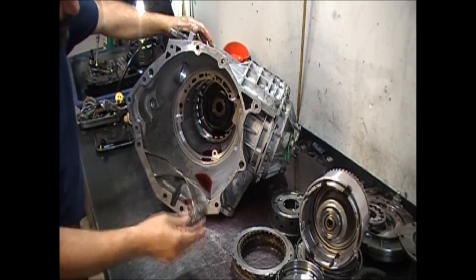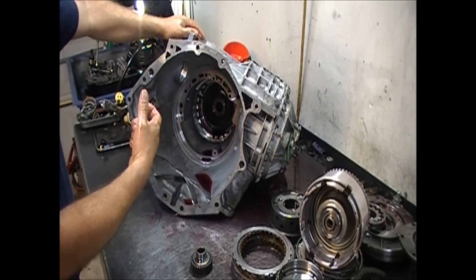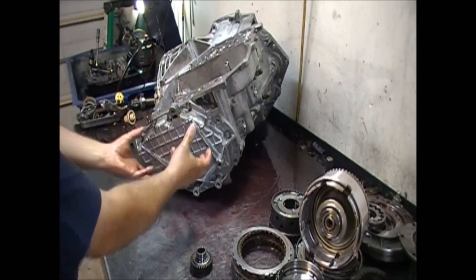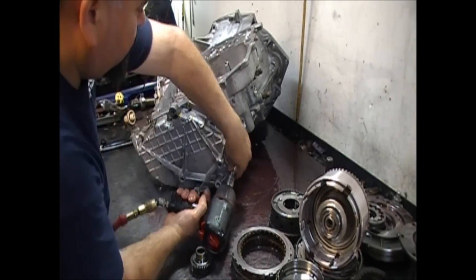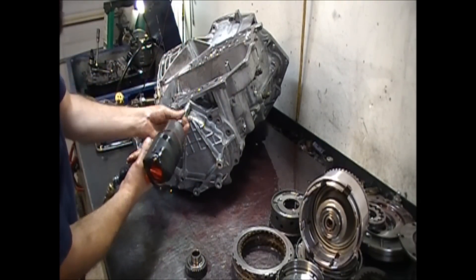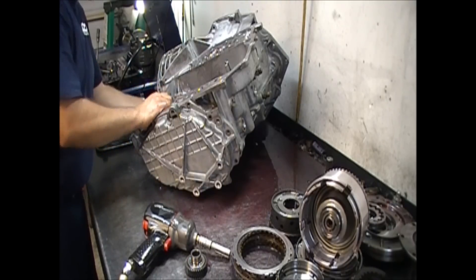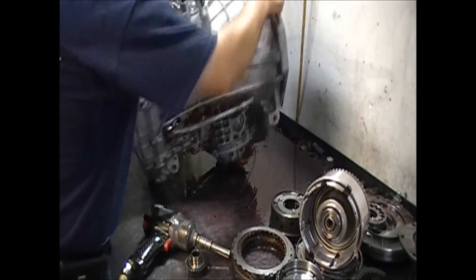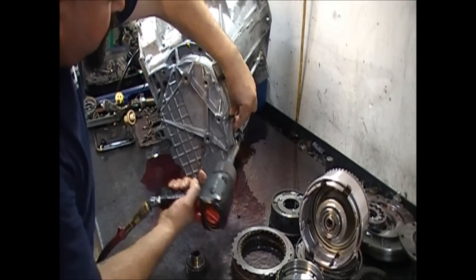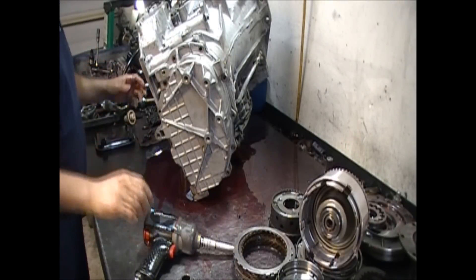In the bottom of the inside you see a sun gear and the rear planetary assembly — it's a five-pinion planet. To get that out I need to get the big nut in the back. I'm going to take this cover off so you can see the rear of this unit. There is also a low-reverse piston underneath that planet assembly. After this we're going to go to the valve body and see what other issues we can find.